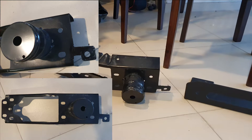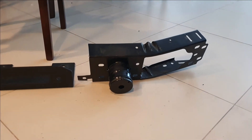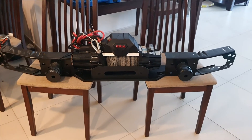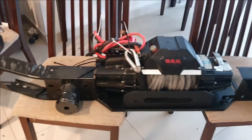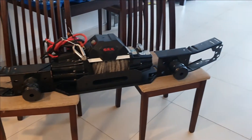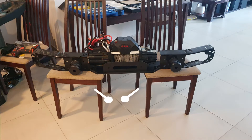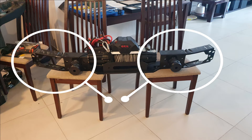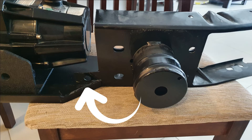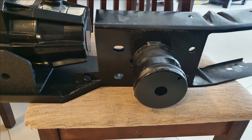You do not need the lip on where the bolt goes through into the plastic, but I thought that would be a nice little extra piece of strengthening. I did previously realize that my winch is a little bit off-center, and now I can actually see how badly off-center it is. This is a rough mock-up of what the winch plate and the braces look like. These braces are from the old brace plate — they will still bolt onto the chassis in the same way they previously did with the added winch plate on the back of it. There's also an extra bolt hole that will be bolting our normal brace plates onto the plastic bumper for extra rigidity, and I will also be adding some more screws through these base plates into the plastic bumper just to make sure they are keeping the plastic bumper a bit stiffer.